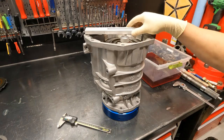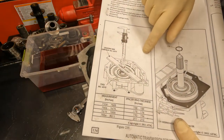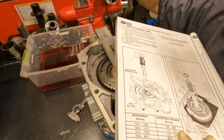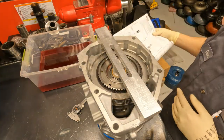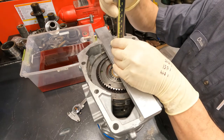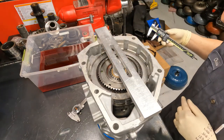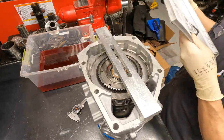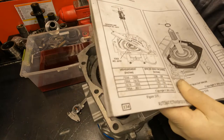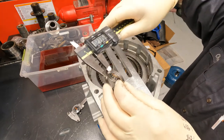You're going to take two measurements using Chrysler tools or equivalent. The first measurement is for the spacer ring thickness — the wedding ring that goes on your intermediate shaft — which determines end play. As the diagram shows, take your measurement. My reading is 0.778 inches, which corresponds to a spacer ring of 0.193 to 0.194 inches. I have a 0.193 here.